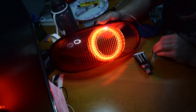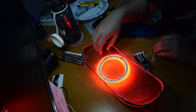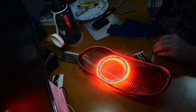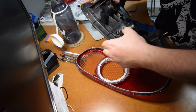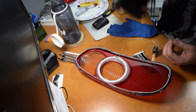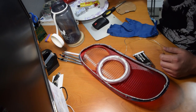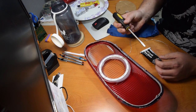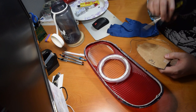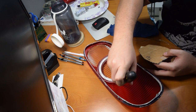We're like halfway there. This is probably the second toughest part next to actually mounting this up. Once we get this wrapped in black, we just have to drill a hole for this wire to come through the back of the housing base. So basically we're going to drill a little hole somewhere under here, let the wire come out, wire that into the regular housing, and then put it back together. I've got some black RTV silicone, a flathead screwdriver, and a little piece of cardboard. I'm going to put some silicone on the cardboard, scoop it up with the screwdriver, and then use that to fill in some of these gaps around here.